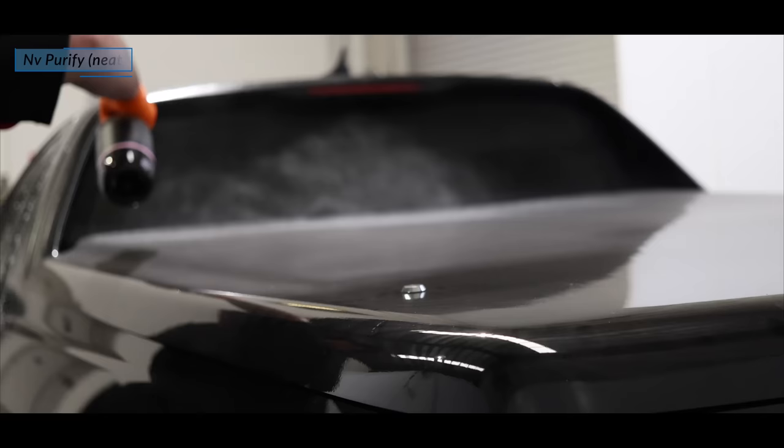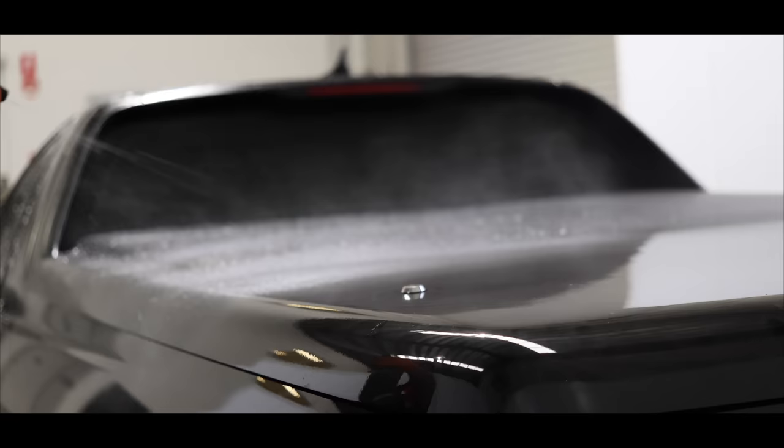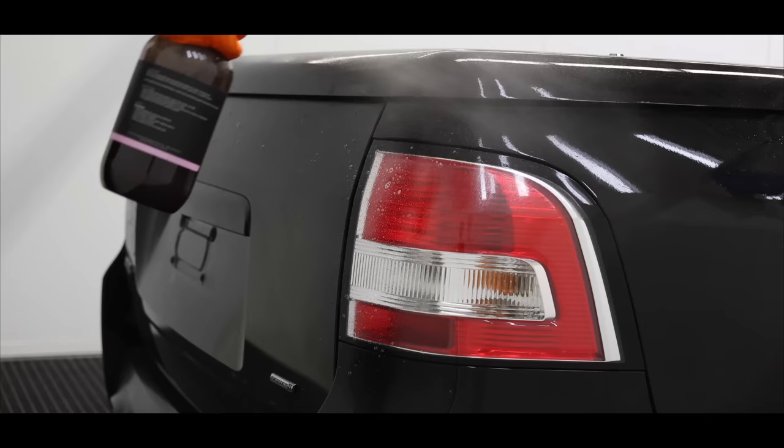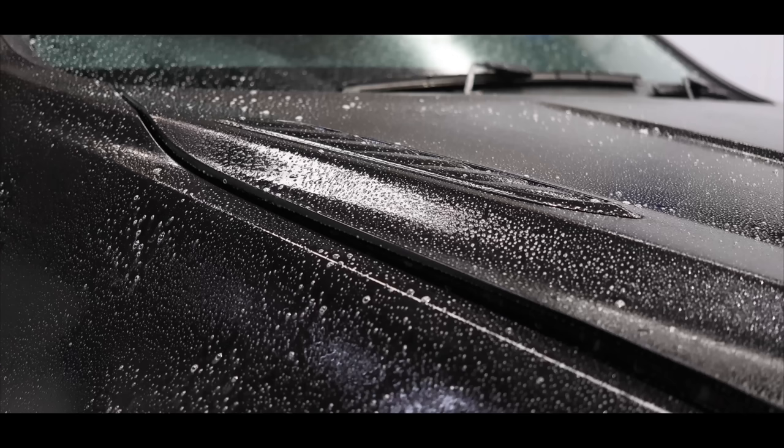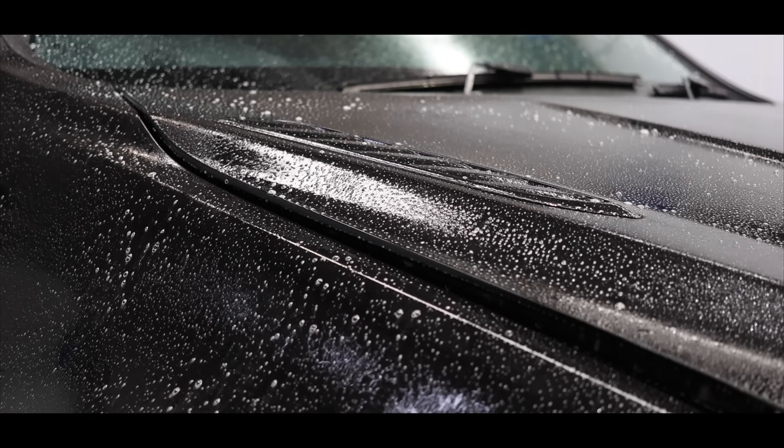With the wheels and engine bay cleaned, I turn my attention to the exterior paint and trims. I started with a pre-treatment of an iron and traffic film remover to begin penetrating the surface contamination. It was allowed to dwell for 5 to 10 minutes, giving it time to react, and was then followed up with an alkaline pre-soaked foam treatment, which was also allowed to dwell for a further 5 to 10 minutes before giving the entire vehicle a thorough and methodical pressure rinse down.